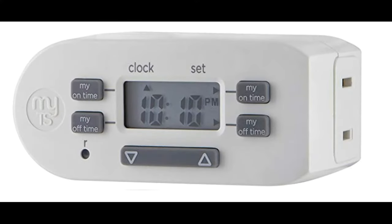I'm putting this right at the beginning at the one-minute mark because these are the confusing parts. See that little arrow pointing to the right — that indicates that the right-side timer is turned on. If you notice that arrow is not present on the left-side timer, that indicates that timer is not turned on. So if you want to use two timers, you have to push the 'My On Time' button until that little arrow appears, indicating that timer is in use. This arrow pointing up points to the word 'clock' because that is showing the current time. Over on the right you'll notice the word PM, and AM is right below it.